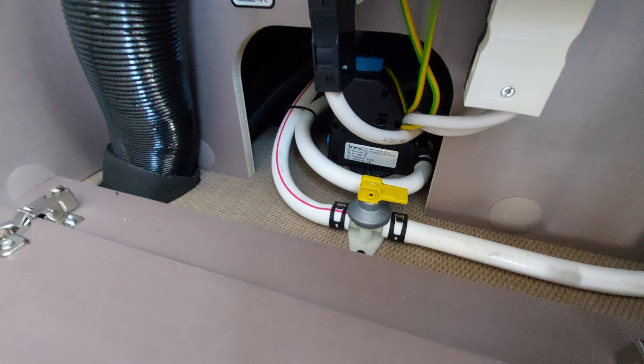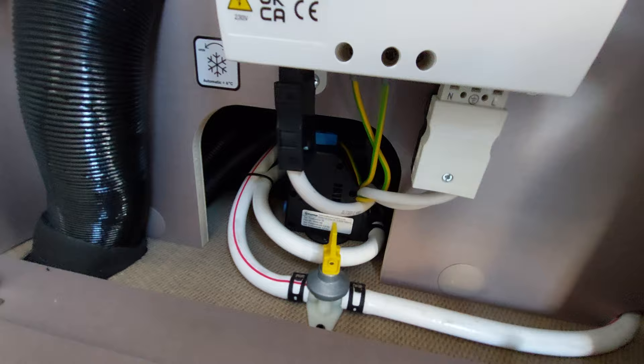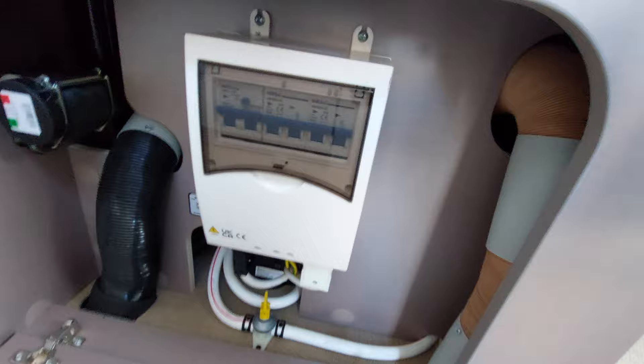The other main drain points in the vehicle can be found under here — two additional ones. You've got this little yellow rocker valve which you'll need to flip down to get the water to stay in the vehicle. It just needs to be down; when emptying, it needs to be in the up position. Hiding just behind that is your frost protection valve — this is a two-part valve: you've got to turn the diamond and then there's a push button at the bottom as well. So there are four things: frost protection valve, yellow valve, and the two valves in this compartment.